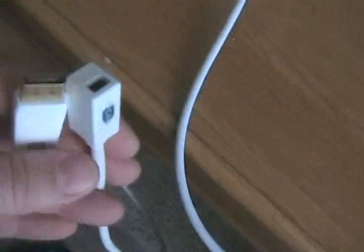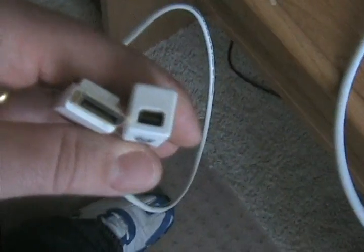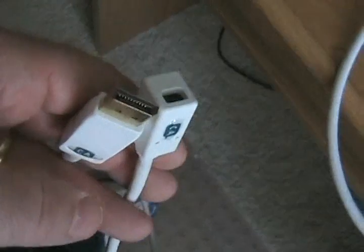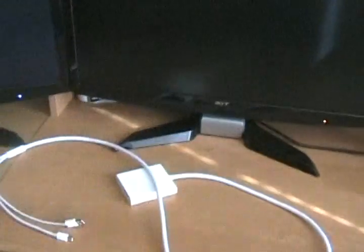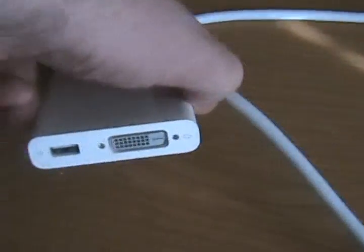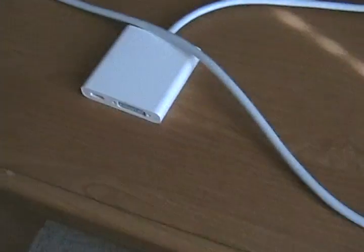So from there I had to buy another cable. This cable comes from Circuit Assembly — you can look them up online. I have a female mini DisplayPort to a male DisplayPort that plugs into the graphics card. And basically it's three monitors here. This Apple adapter here has my DVI from my third monitor. Here's my third monitor, and I have the cable here. This cable is going to plug right into this one here, and I'll show you in a second how it all hooks up.